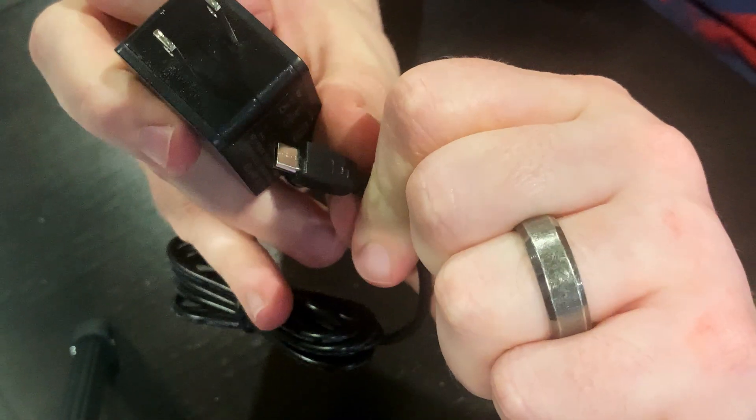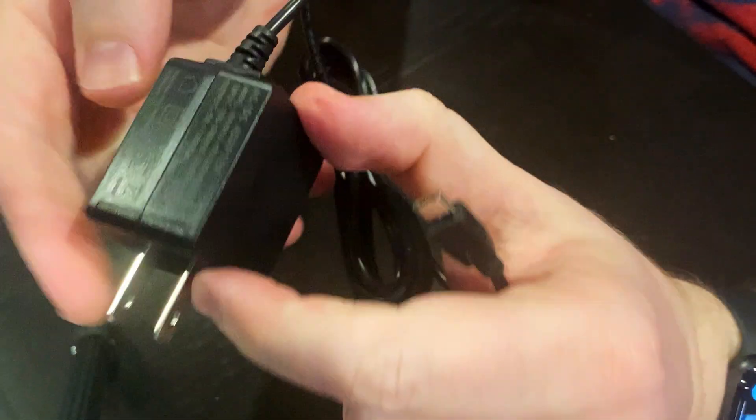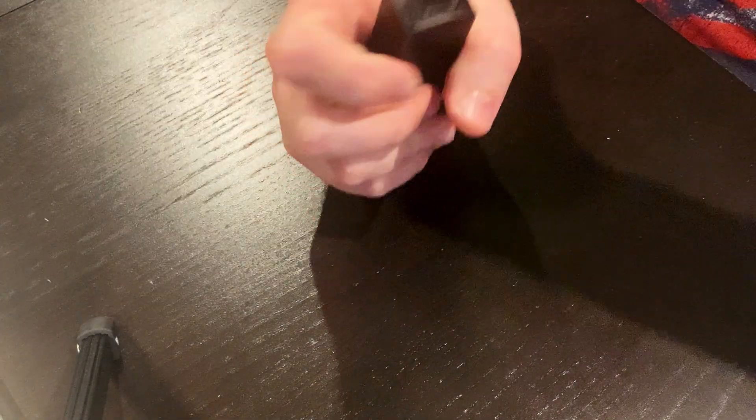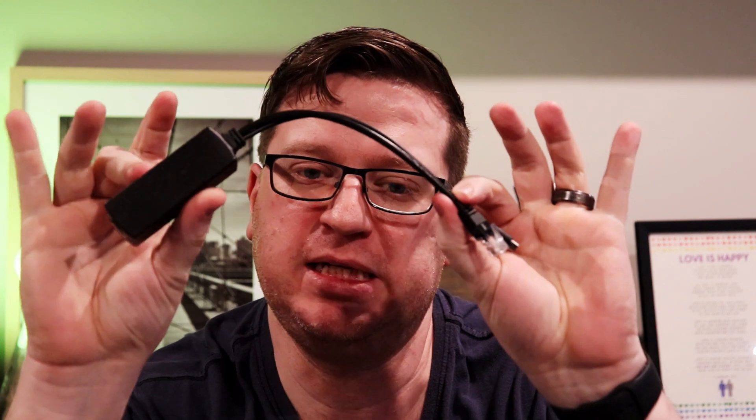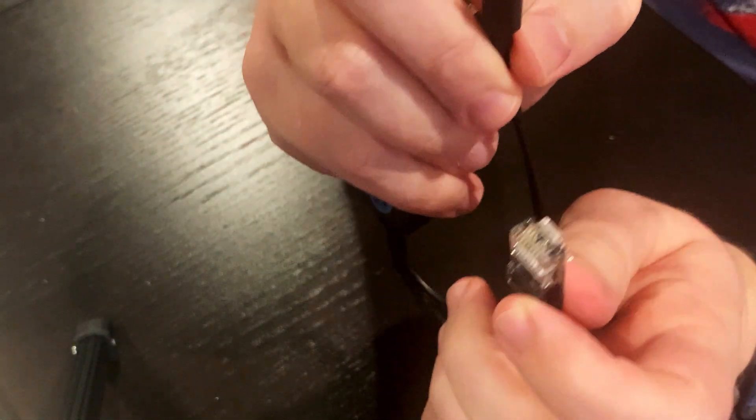This power adapter is obviously not going to work for me — it's got the wrong inputs — and I don't particularly like these wart-style adapters for USB powered accessories anyway. The good news here is that you can use any USB power source to power this unit, even an old phone charger. I happen to have been very lucky about a year ago to pick up a power over ethernet gigabit switch, and I grabbed some PoE splitters that take power over ethernet from the network switch and split it out into a micro USB plug and an ethernet cable, so I'm going to use one of those.